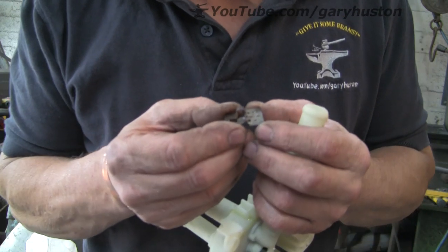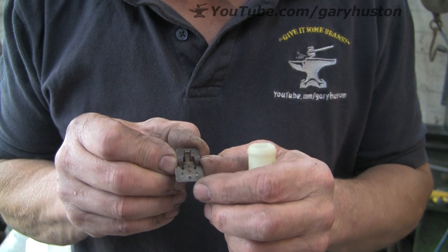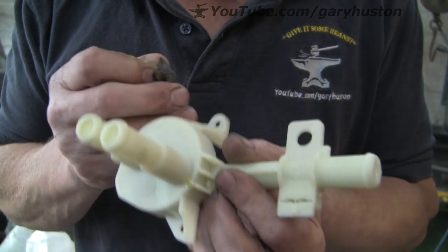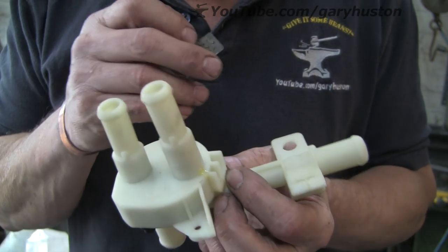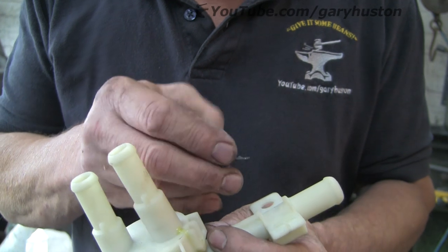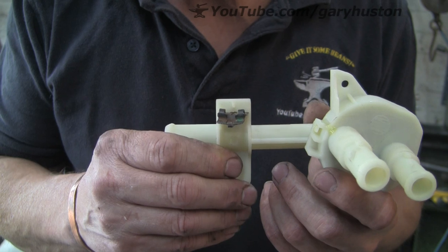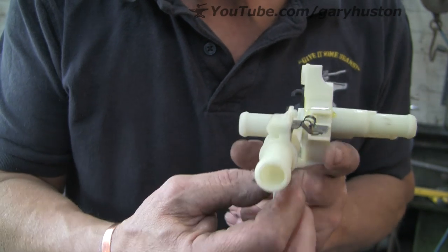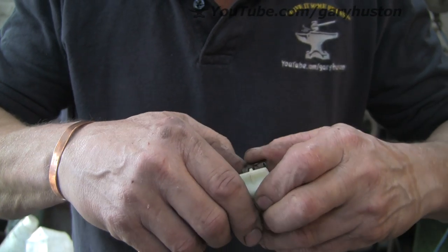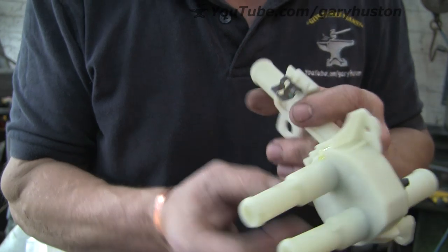On this clip, it's got two barbs going back to front on one side, and on the other side two barbs going left to right. They correspond to some grooves in the housing so just make sure you get it the right way up. The left to right ones go at the bottom, the back to front ones at the top. It should only go in one way easily — with the little clip hanging down, it literally just pushes in with your fingers, the barbs grip and it won't come out.